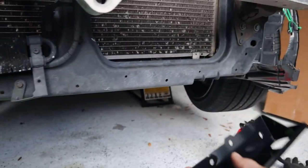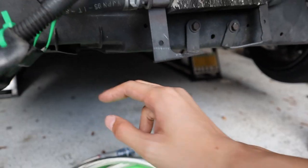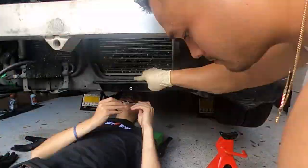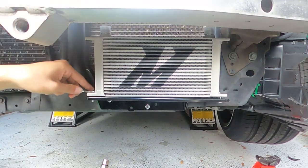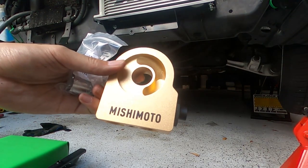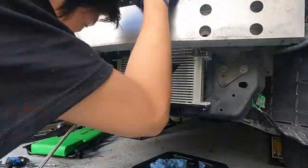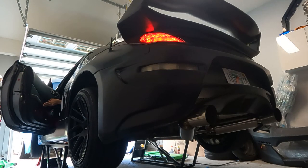This bracket is supposed to line up here and then the oil cooler on top like that. You have your two braided lines that swing down here and you have to mount them properly so they don't get caught by the sway bar, the tire, or the control arm going into the oil filter. It should be pretty easy. Let's go ahead and drain the oil and take off the oil filter in order to install this oil spacer thing for the oil cooler to operate.